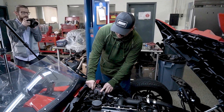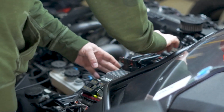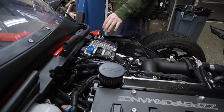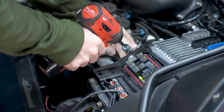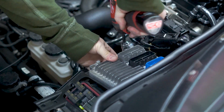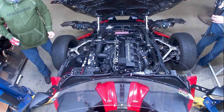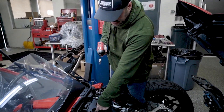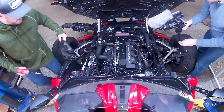You'll start by removing your three connectors on the PCM tray. To remove the connectors, you're going to pull down these little red tabs, push down on that center button, pull up on this lever, and that'll bring all your connectors up. After that, just remove each connector and push those off to the side. Next, we're going to remove the two bolts holding your fuse box in — this is going to be a 5mm Allen. Next up, we're going to remove the PCM from the PCM tray by removing these two 10mm bolts. Once you've got that PCM out of the way, you're going to take off the actual plastic PCM tray. You'll find two T40 Torx bolts here and here, and there's a third one down here. Sometimes an extension will help reach down in a little bit better. After that, lift your PCM tray out of the way, and you're done.